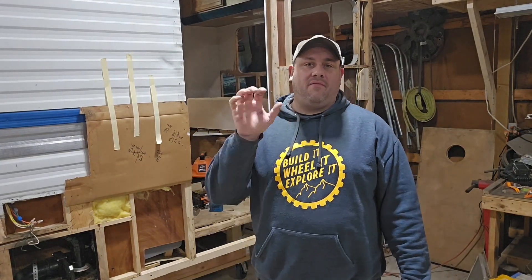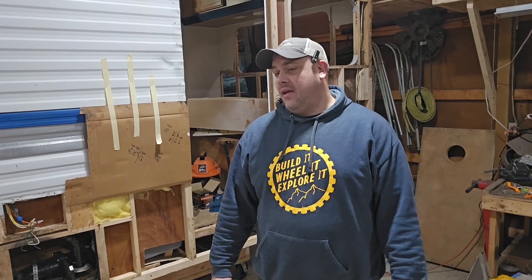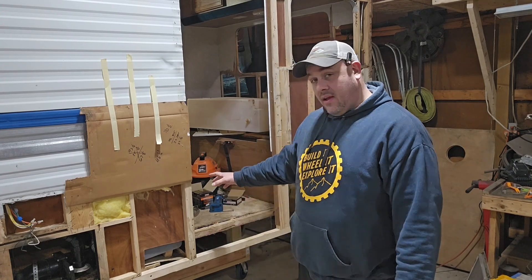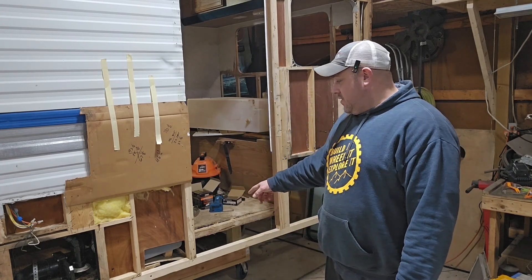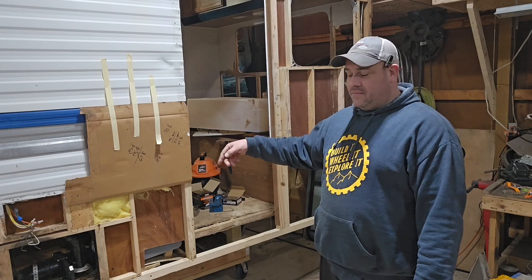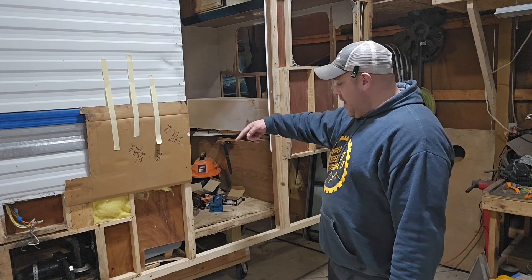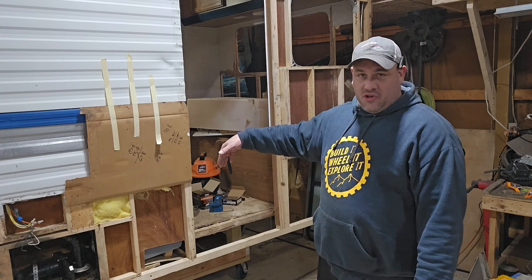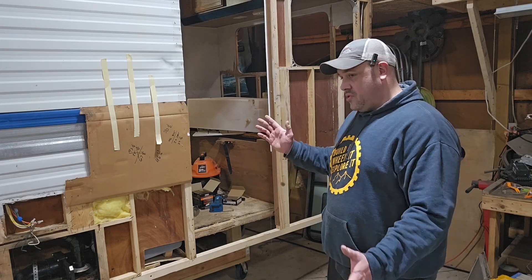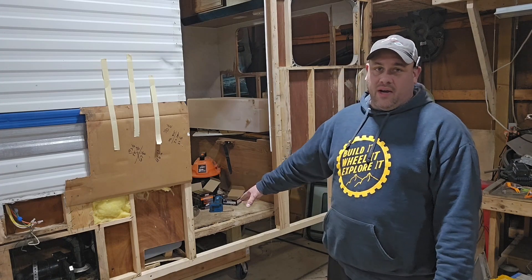Welcome back, this is part five of the camper truck camper repair series. I'm going to move on and start working on the floor. I took a metal carpenter square and double checked my line — I was off, so I made a new straight line on the floor. I'm going to cut that nice and straight, exposing a little more of those floor studs or trusses, then start framing the entry floor area.